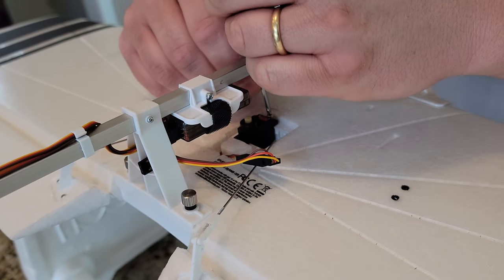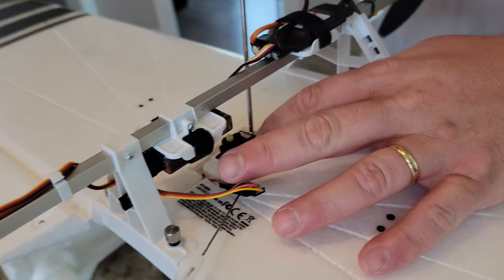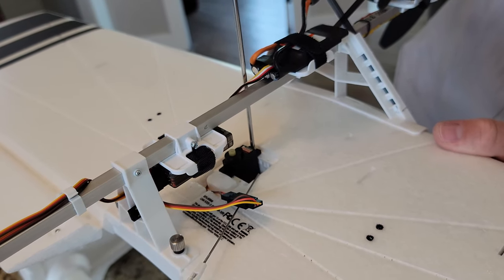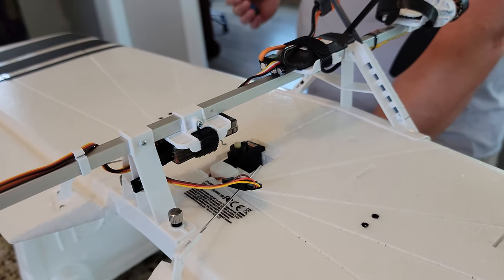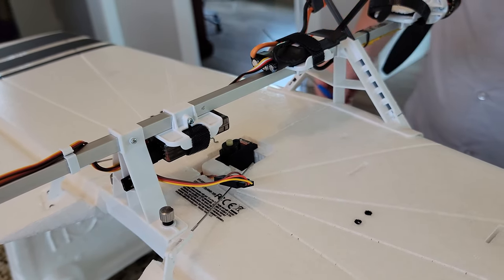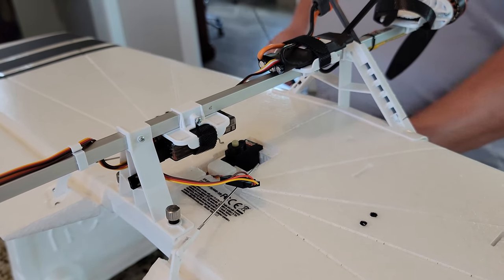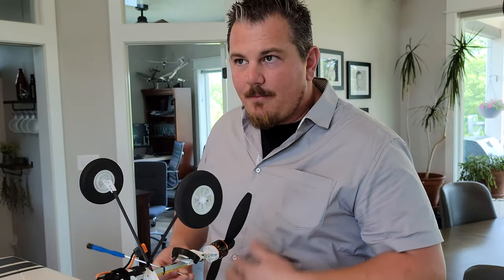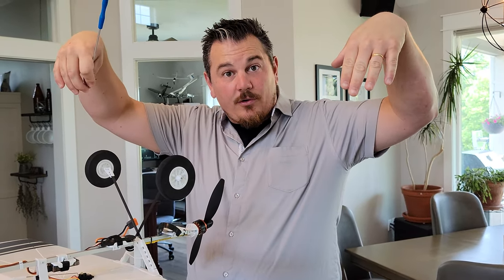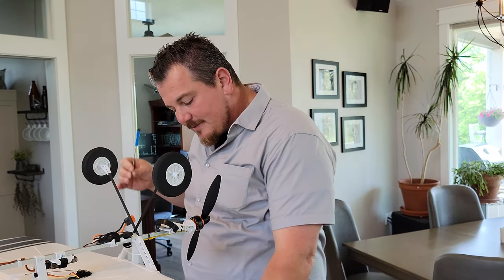Now, keep in mind, because these are Flapperons in our case, you can set them up as Flapperons or Spoilerons. Now, what's the difference between Flapperons and Spoilerons? Spoilerons are designed to either go up, down, or act as an aileron, which is up and down. So they can go the same direction at the same time, but essentially they're not just going to drop. That would be a Flapperon. Flapperons drop and continue to act as ailerons. Spoilerons would also raise together and continue to act as ailerons.